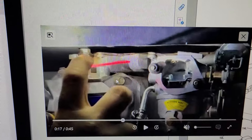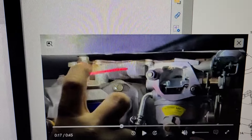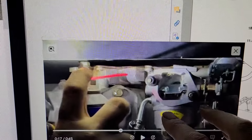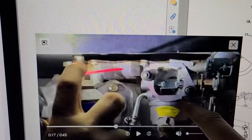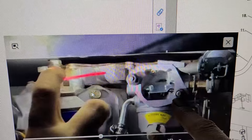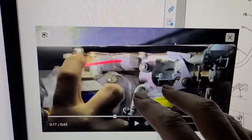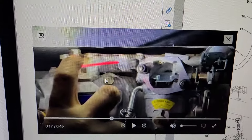Another tip: notice he's running it without the air filter cover on. To do that, you need to put your nuts on here because if you don't, the carburetor can't seal against the engine and it won't run. I think there's a shoulder so you may need to put a 3/8 nut as a spacer, then use the 10 millimeter nuts to tighten the carburetor cover down. That way you can start the engine and troubleshoot without that big black filter cover hiding all the linkage.